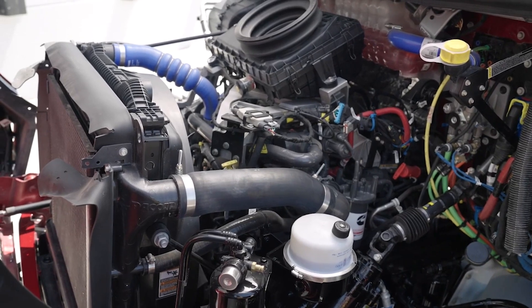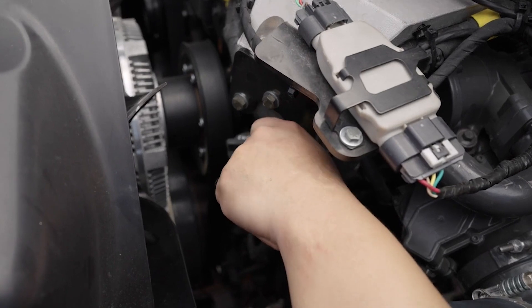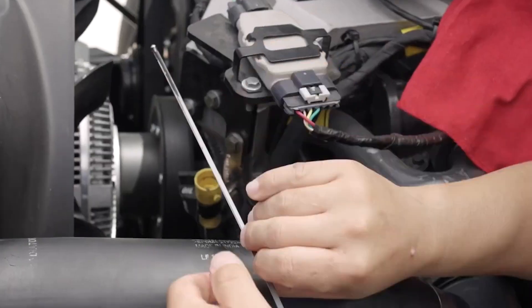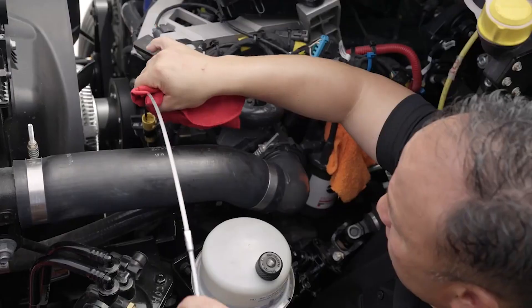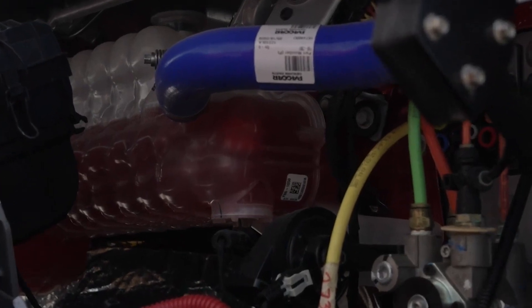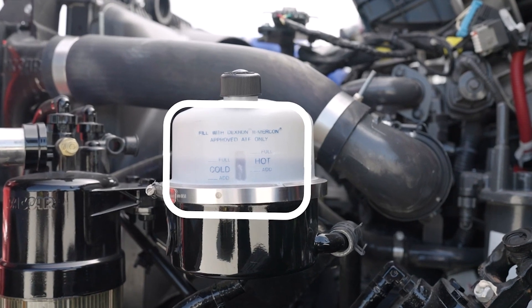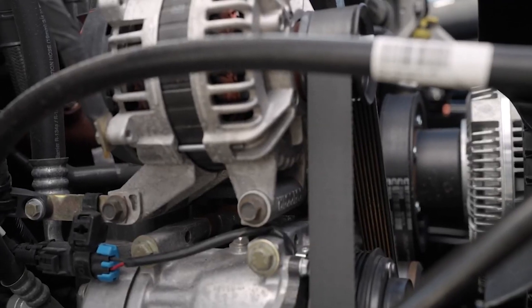Checking engine oil is vital to the performance and lifespan of your vehicle. Take the dipstick out and wipe it with a clean rag, then reinsert the dipstick and check that the oil level is between the low and high marks. Inspect the vehicle's coolant surge tank for proper coolant level and add coolant if the level is below the MIN mark. Examine the power steering fluid reservoir to confirm it is above the minimum indicator level. Check all belts for any wear or corrosion.